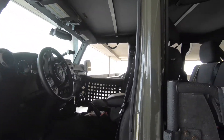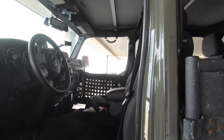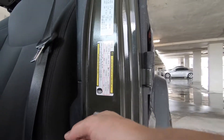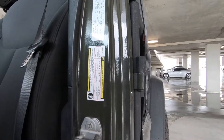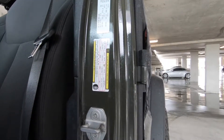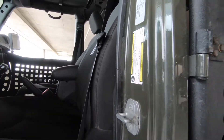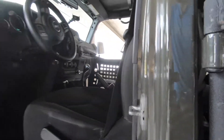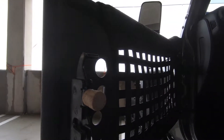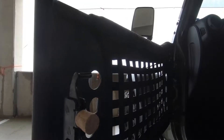There's a different solution for the front and for the back. For the front, you can see that the bolt is right behind this panel on the door. The way to resolve the vibration and rattling issue is to get a vibration isolator between there. What I've done is taken a wine cork and some outdoor double-sided mounting tape — something like 3M.